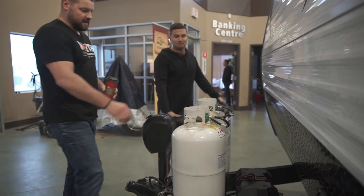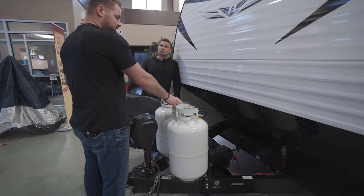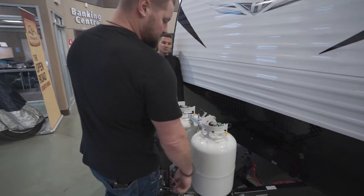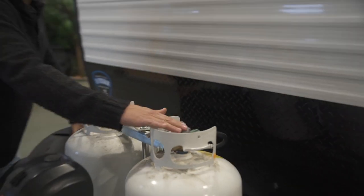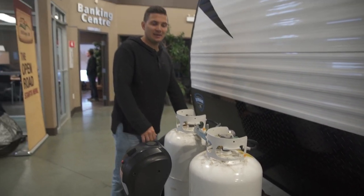And then you're going to want to disconnect this. If you're going to a gas station, I guess, to fill up your propane, in most cases they'll help you do this. Yep, just a wing nut in the center. That'll loosen this bracket, slide that up, disconnect this. Again, make sure the valve is off, slide out your tank, get it filled, put it back in the reverse procedure.